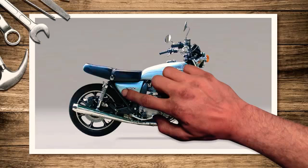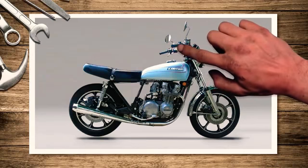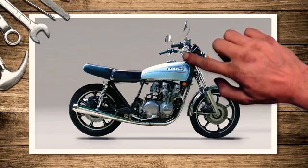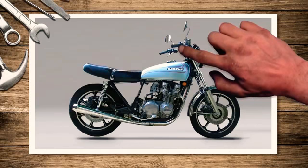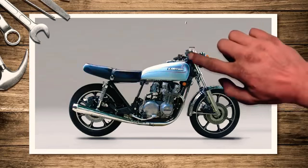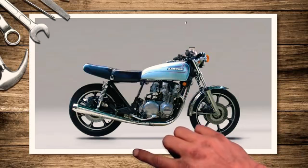Pods - if you're going to go off-road, probably not the most sensible option to use those, but I like them anyway. So I'm going to take this off and I'll take the little sleeve off as well. The next thing we'll tackle are the handlebars. The difference between a scrambler and a cafe racer: in a cafe racer, you've got the clip-on bars down at the bottom. For a scrambler, you need more control of your bike - you're going to be off-roading it. So we'll take these massive handlebars and mirrors off and put these neat little bars back on. Not as high as the last ones, but still high enough so you can get your hands around it and keep control of the bike.